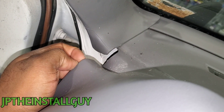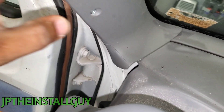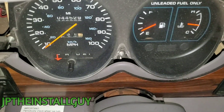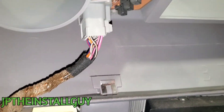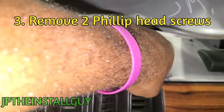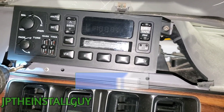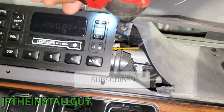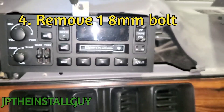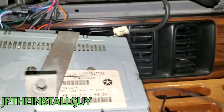You can try to go up under the A-pillar like that — nothing broke, that was just it slapping up against it. Or you could have just taken that screw out; I'll probably end up taking that screw out to put it back on so it'll be easier. Now you have one harness right here that you don't have to take out. We're going to take this screw out and that screw up there — both Phillips head screws — plus one 8-millimeter bolt.